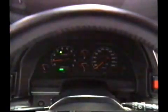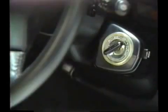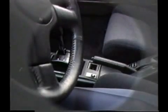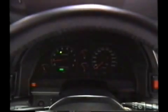Three, stop the car and check the blinking of the warning light. At this time, by switching the ignition switch off or switching the parking brake switch on, the results of the speed sensor check will disappear from the memory, and the normal diagnostic code should be indicated.